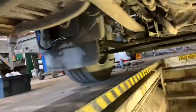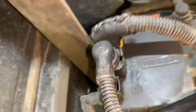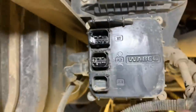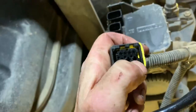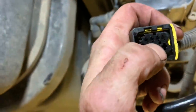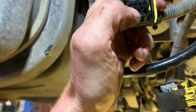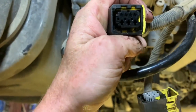Apparently both them front sensors — both of them. And now I've got a signal off that one at the front bulkhead. I've just been speaking to DAF, they said, 'I don't know how you've got a signal at the front bulkhead, it shouldn't go there.' Both of them sensors lead to there — A4, A5, A6 and A7. I just took that plug out of that top plug. On there it's got one, two, three, and then the top four are four, five, six, seven. So I bet four, five, six and seven are both front ABS sensor ones. That's what I'm hoping anyway.